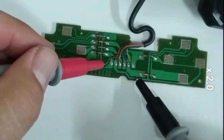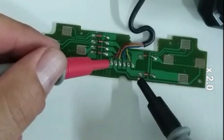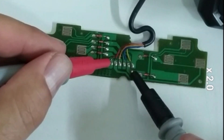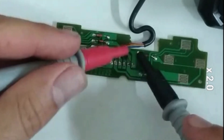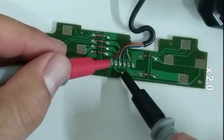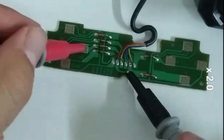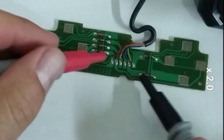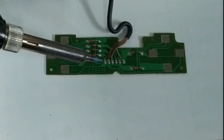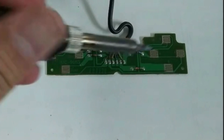The Amstrad joystick requires seven wires if you're including the second fire button or fire one. This controller has only got six. So I'll make a sacrifice and just use the six wires here, reuse these wires and just have one fire button, because not many games at all use the second fire button. So now it's just a matter of wiring up the four directional switches and the one button switch and include one ground. The first thing I should do is remove these six wires so I can reconnect them directly to the switches.